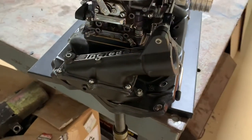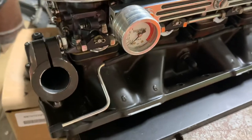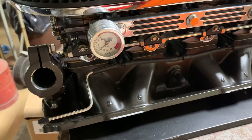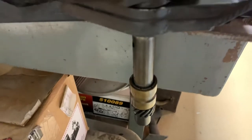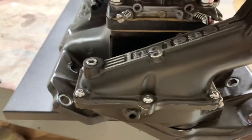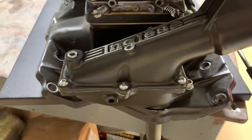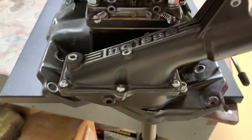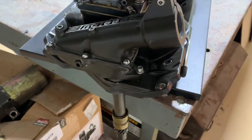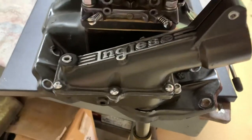Small block Chevy distributor. You do cut the tang off of the distributor gear when installing it for clearance, but as far as the shaft going down, it's got the same shaft as a small block Chevy distributor. You've got your oiling ports right here and right here. I'm going to try it this time with gear oil in here, like a rear end — 90 weight gear oil. Not sure how it's going to work. If it doesn't, I'll go back and plumb it into the oil system of the car.